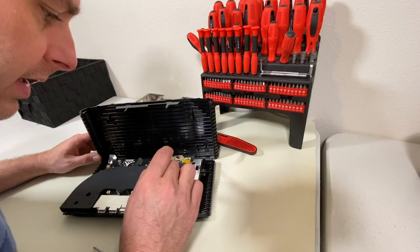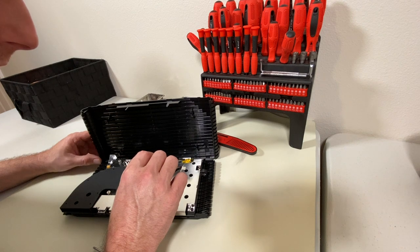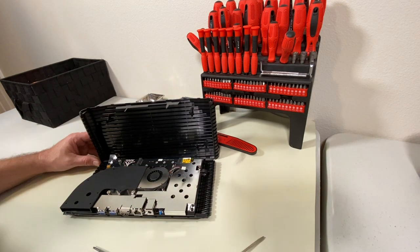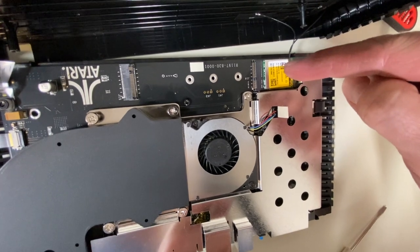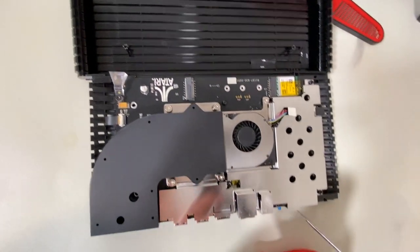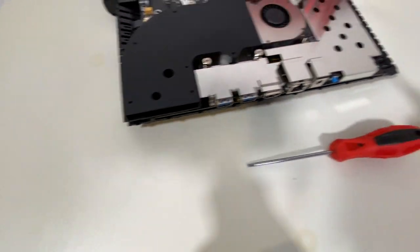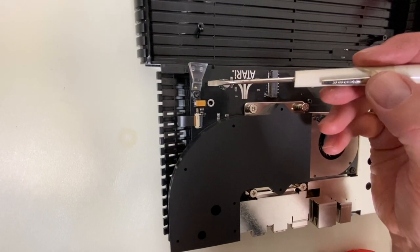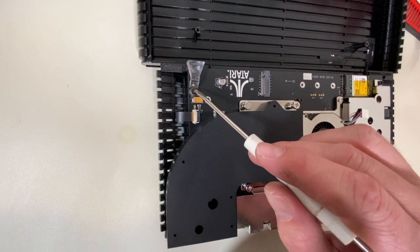So be very careful if you're going inside of here. Here's the chip — this is a Realtek chip for the actual WiFi. You can see that the WiFi's MAC address is also printed on this particular chip. It's almost like this is upgradable — it looks like it's in some sort of slot where it could be updated. Here we see a fan with a shroud — it's got a nice air baffle. This is the light for the front end, so when that logo lights up, this is the diffuser that takes the light up to the front of the panel from the main board. There's a small LED underneath there.